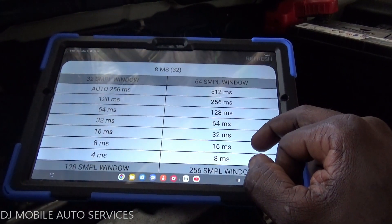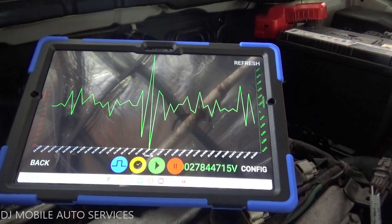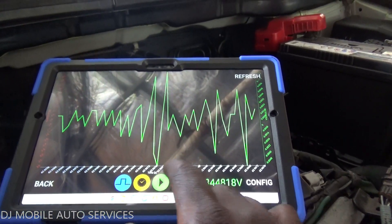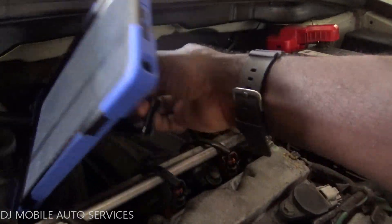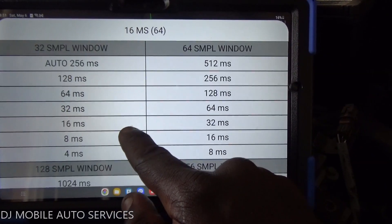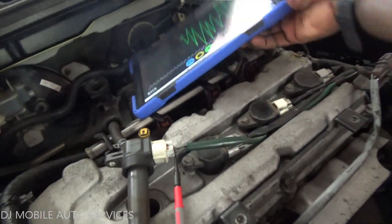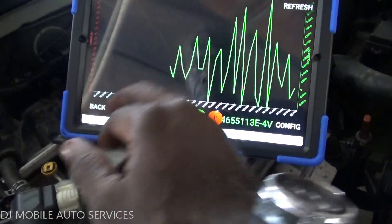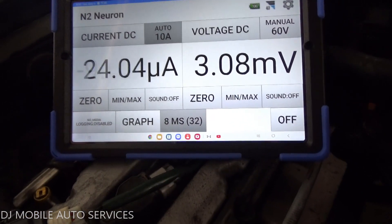Clearly I'm missing something, and it's not from the ECU — this car came in driving and stopped starting after the engine replacement. So the problem has to be this engine. I'm just doing these checks with a multimeter to verify power, ground, and signal to coil number one, confirming that the crank and cam sensors are not sending signal, causing the vehicle not to start.